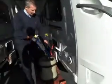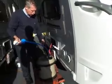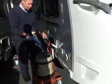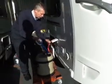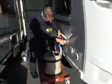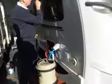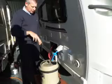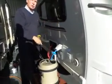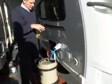What it does, it's a pump on board, it draws the water through the middle of this. If you want to fill the onboard tank, you open that up, see the little electrical 12 volt connections? You plug it in there, then you go inside, it'll switch over the door, you press tank fill, and this will transfer all that into the onboard tank. And the pump on the end starts whirring. Yeah, can that be done from a tap as well?